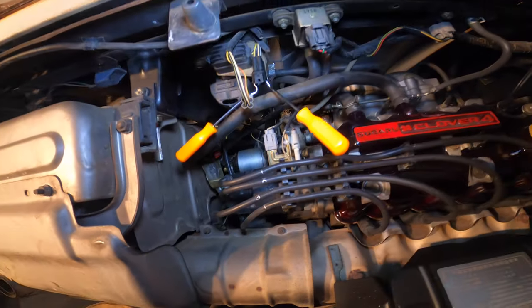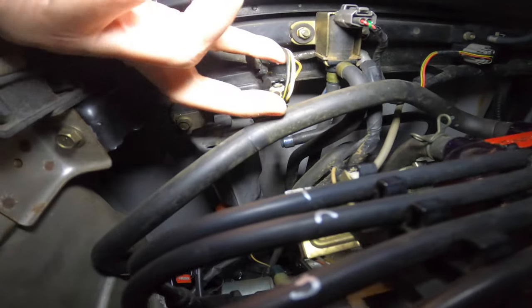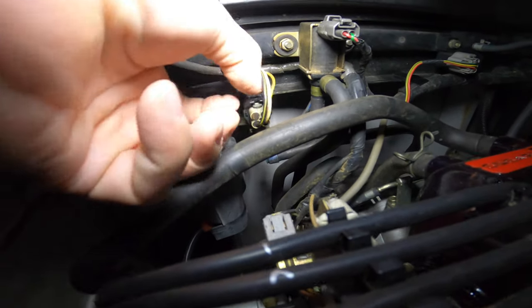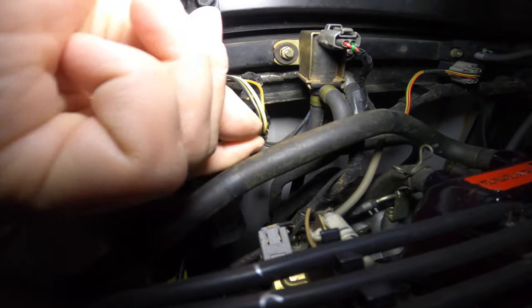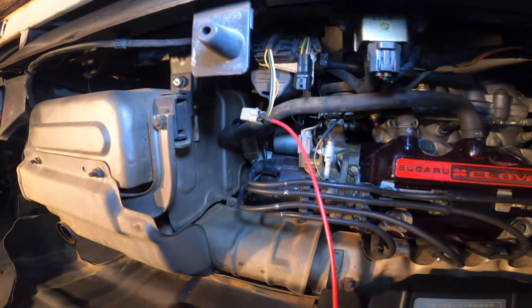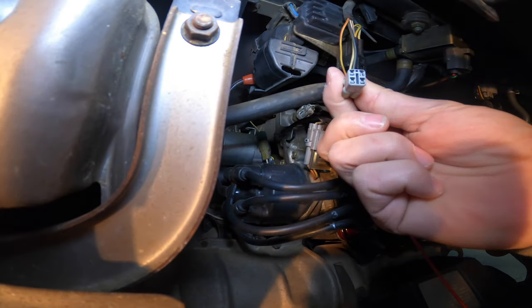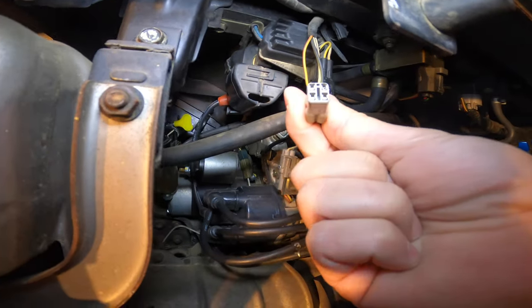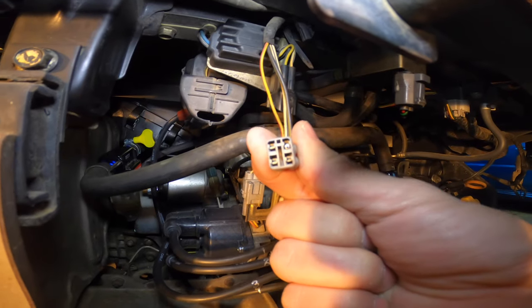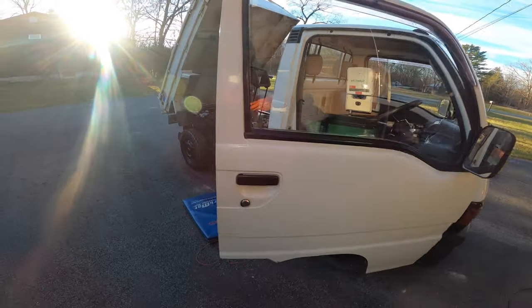It did eventually come out. Now you have to remove that rubber plug and add a wire so that it actually matches up with the pin that's inside the resistor's end. I had 24 feet of 14-gauge red wire laying around, so I made my own wiring harness and plugged it into the port where there was nothing.